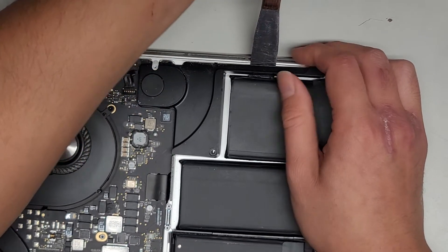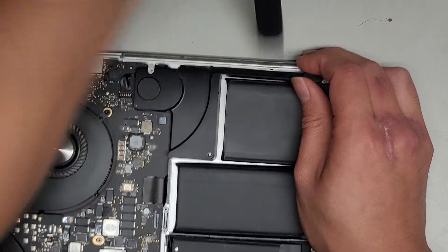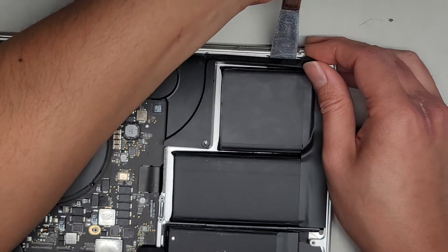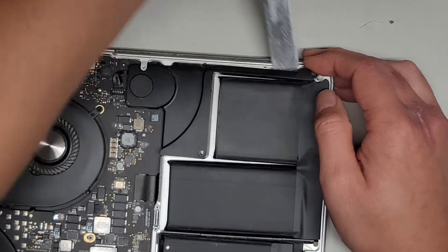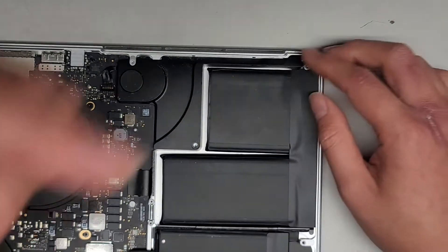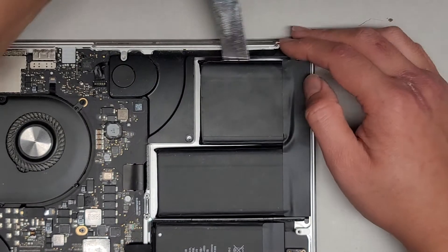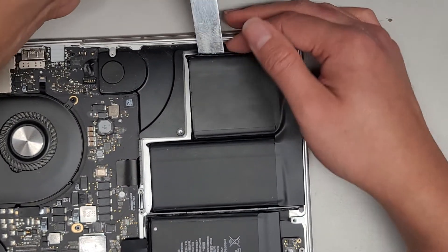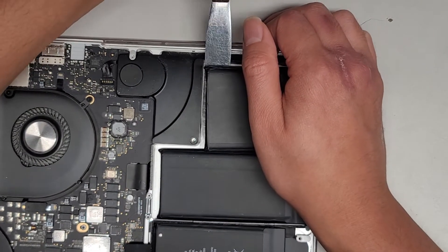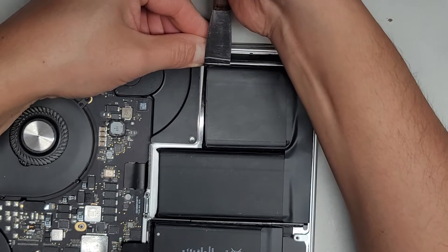If you're doing this, you want to be very careful that you don't damage the speakers. I had one person tell me they used a different kind of tool and ended up lifting this thing up too far and cracking the speaker. There's a bunch more of the speaker underneath the motherboard, and if you break the speaker, to replace it you have to take the whole motherboard out. It's somewhat of a pain, so you want to be careful with that.